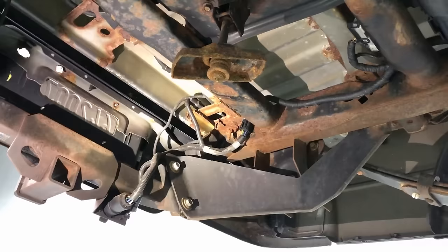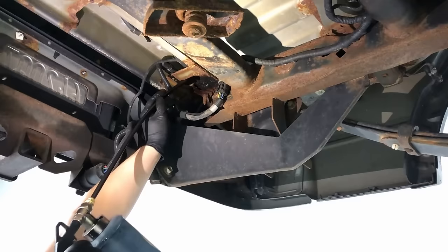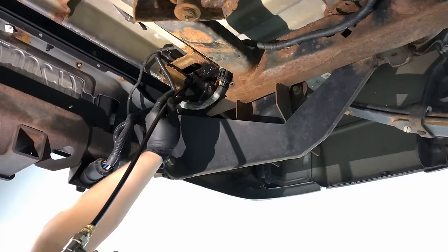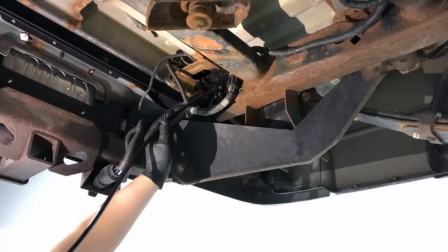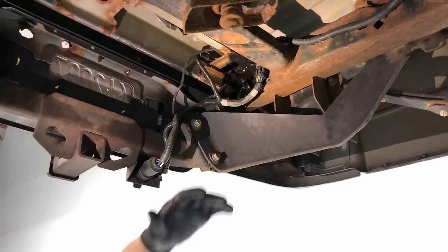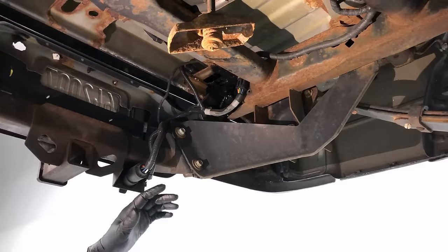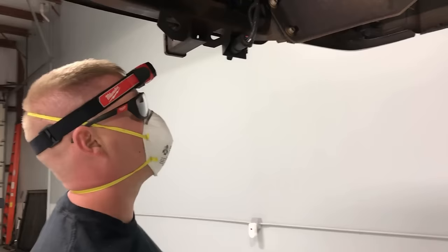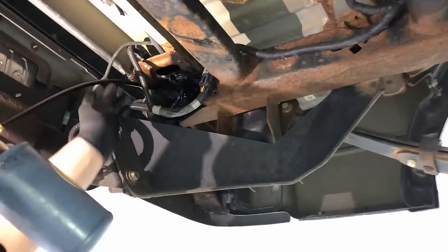Now we're ready for the messy part. Safety glasses and basic respirator are on for the fine mist and vapors. The gun is fully set up with the regulator at about 90 PSI. I'm using the flexible extension with the straight shot out the end, starting with all the tight areas first, then cross beams, tubes, and the frame with the 360 wand. The plastic drop cloth is down. This corner right here is a perfect example of where you want to use the straight flexible wand.